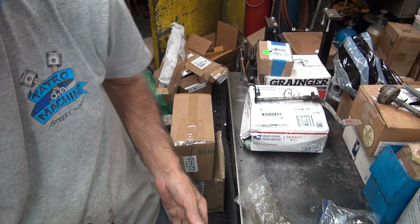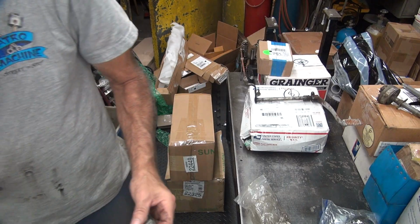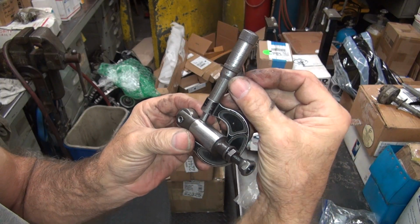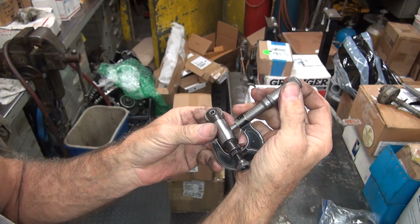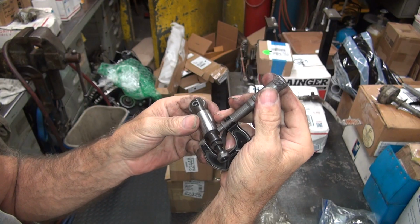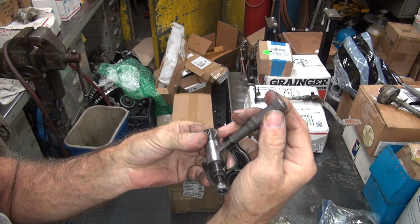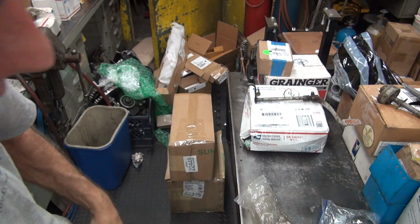So let's see what's going on with the lifter diameter. Let's see what they did here. Okay, see how it's on 5 on the mic? That's a standard size. 5.5 is about stock. See it right in the middle? That's the original size, 5.5. Rarely do you ever see 6, and 5 is getting worn. When they get down to here, you see how it drops off a little bit. When it gets down to 2 thou under the 5, which means 3, it's worn out. So these aren't worn out, they're just worn lightly. So these can be used, but they're definitely way too tight.